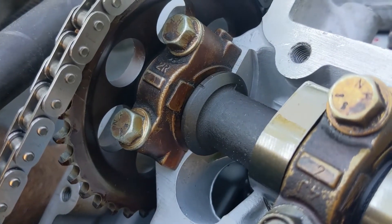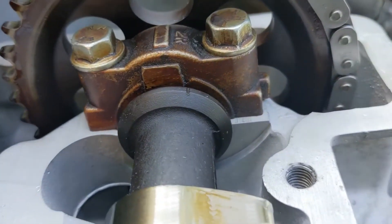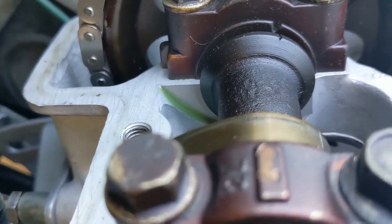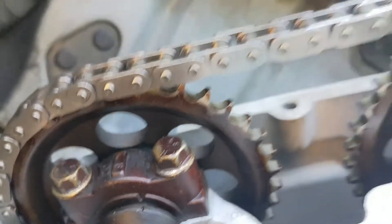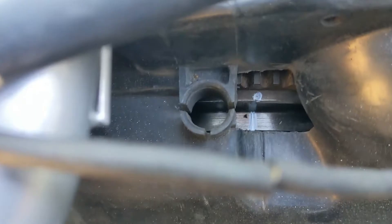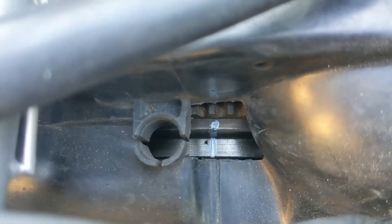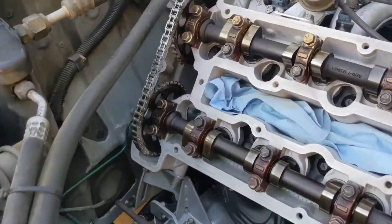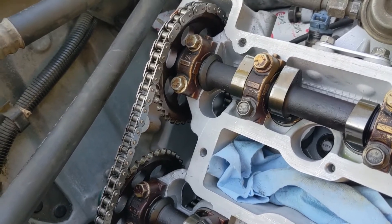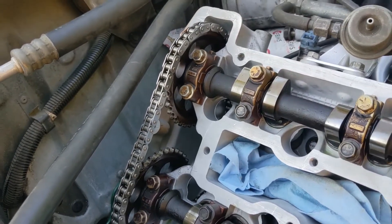It may look a little off on the camera, but it's lined up here. Looking at the intake cam - which looks awesome. Going down to the exhaust cam - that's perfect. Then we need to do a final check here, which is again perfect. The line in the cam cover is lined up with the mark I've made on the flywheel. So this car is done. You'll see there's still just a tiny bit of slack here, but as the engine's moving that slack is gone. As the chain stretches a little bit - it's a brand new timing chain - the tensioner will take up that slack.